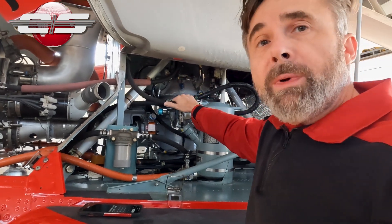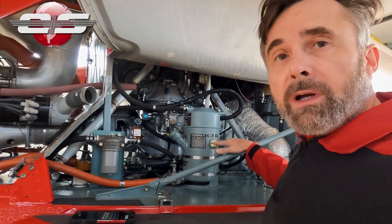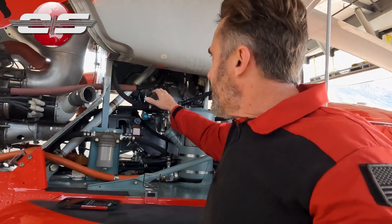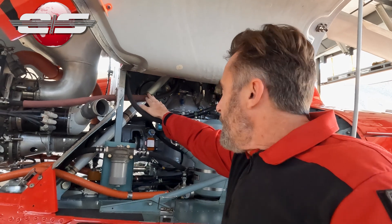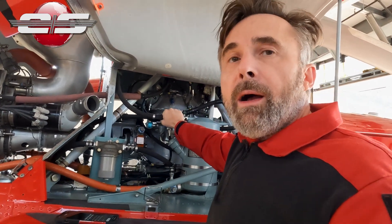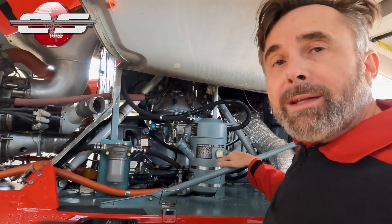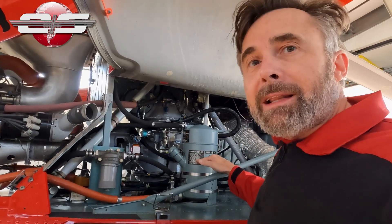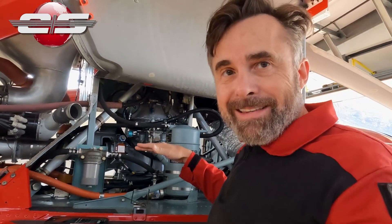Now, if there's too much suction in here, it will suck the oil out of the reservoir, and how that suction is adjusted is by this loop right here. This loop is adjusted to make more or less suction occur from this tube. So, if the oil level is going down and there's no mechanical issues with your helicopter, and it just stays at a level and doesn't go any further past that, most likely you have too much suction on this line. So either that loop needs to be adjusted, or you can also make sure that you don't have any carbon buildup on the exhaust tube.